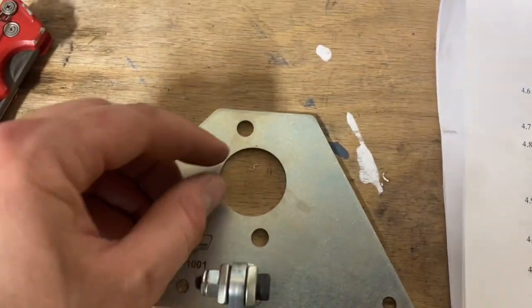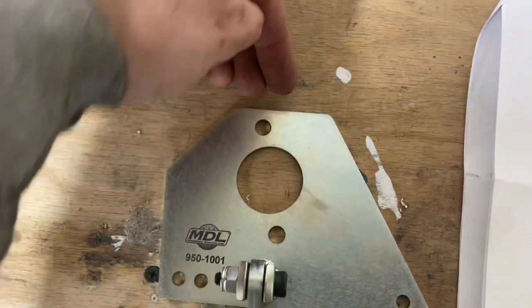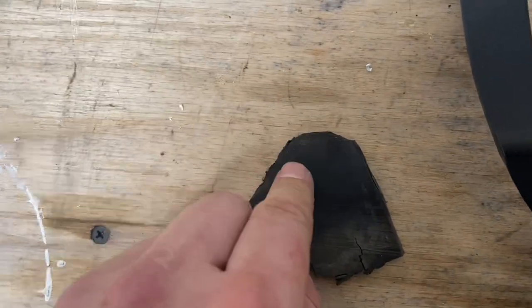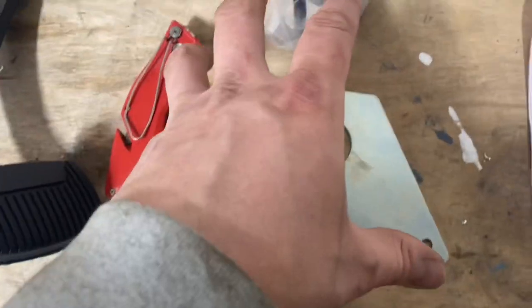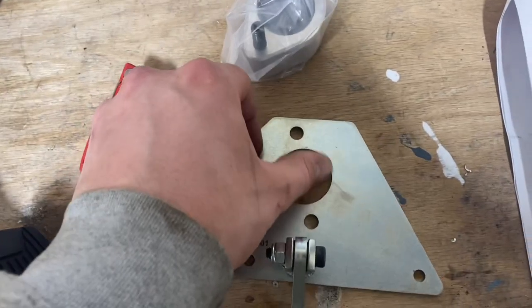Initially I thought I was going to take a hole saw and drill through the firewall, but that's not the case. The hole you're going to drill is right here. Inside the car, at the bottom of the pedal assembly, you slide this up until it hits the top. Then sliding left and right, what you cut out initially is like a circle — I'm going to have to go in and make it more like a semicircle — effectively lining it up so the hole goes straight through. I need to mark this, drill the hole, and use a sharper razor blade to make it more semi-circular so the new master cylinder can slide through.